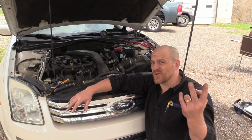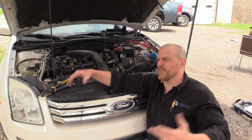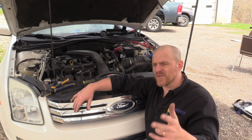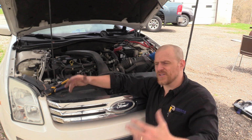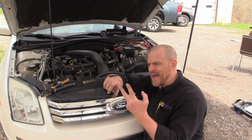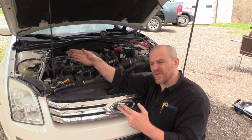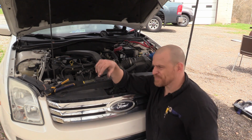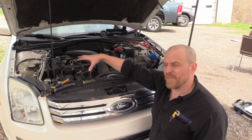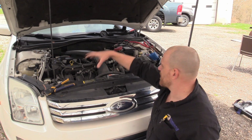So there's two ways to turn a driver on. One, bidirectional controls. Well, we didn't have them available. So two is to meet the conditions that the driver needs to turn on. That's the only other way to check it. So if we had a driver issue, we would still need to check the wiring integrity between the driver and the computer and the relay, okay? So there'd be that part of the circuit. Of course, you have the pump itself, powers and grounds to the pump. Does it run? We're kind of doing the relay and the pump together.